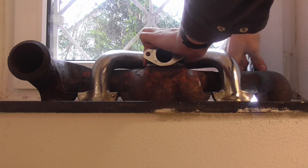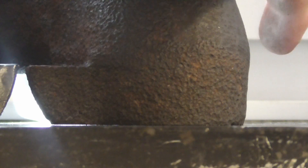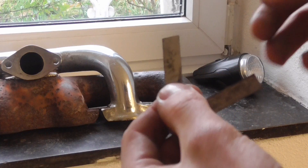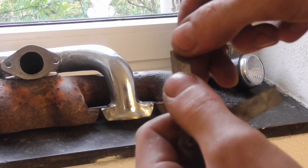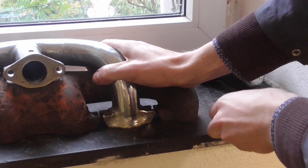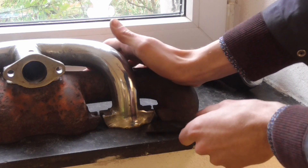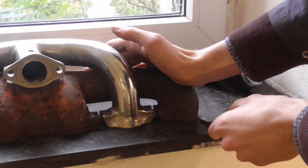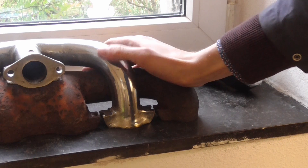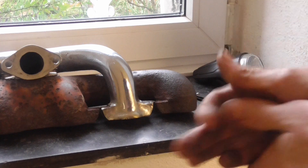There is no light coming past here whatsoever. Okay, let me be honest — there is actually a gap right there towards the left. This feeler gauge is showing ten — which is one tenth of a millimeter — and this one is five hundredths of a millimeter. The ten doesn't fit under here, and the five just fits in the corner over here, but not on the other side. So we are about five hundredths of a millimeter out — but that is exactly what gaskets are there for.